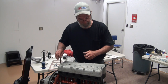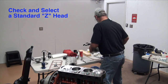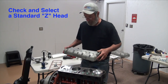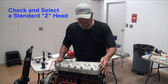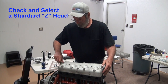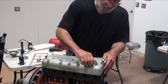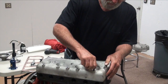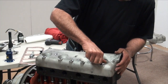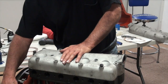We're trying to just build a dependable engine and not a real hot one. So I'll set that one out of the way. I have another Z-head here that hasn't been milled. If I set it on top of this engine and use a couple of bolts to kind of line it up where it should rest — I can spin the engine through and it's not hitting.